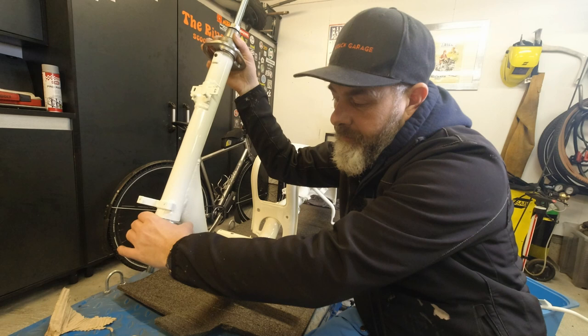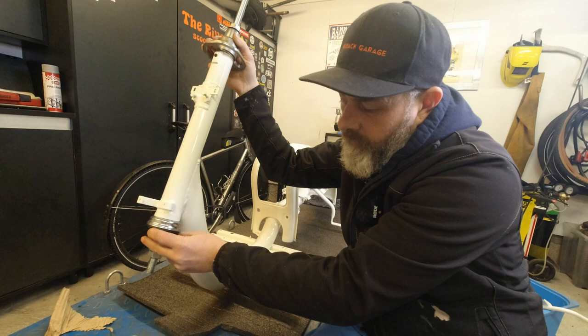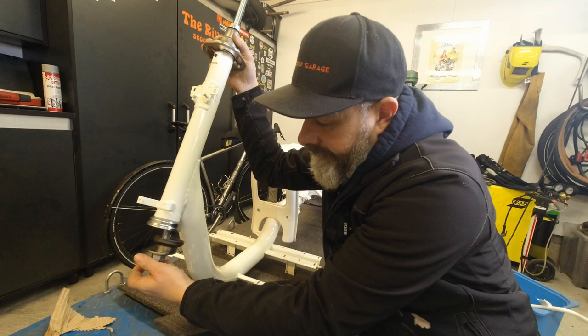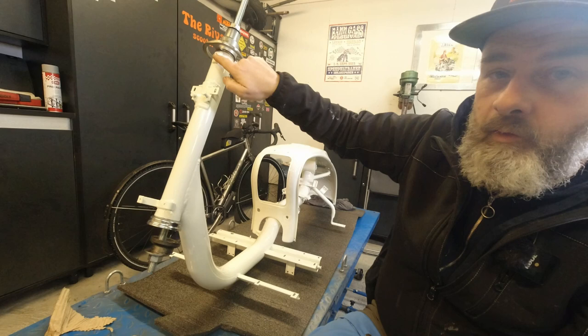I pressed in the lower race first, and then put on the silent block, and then fit the lower crown with the guard. It's not quite pressed in yet - I can still move it a bit. I used the bottom race upside down and a big fat washer to pull in the lower one. So what I'm going to do now is fit the upper race in the chrome ring, and I've also fit the grub screw there as you can see.